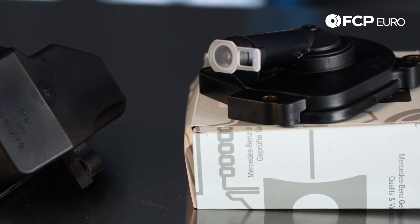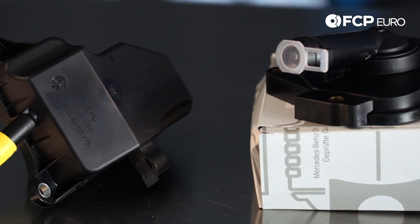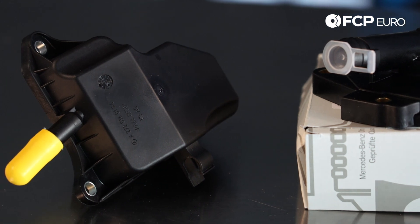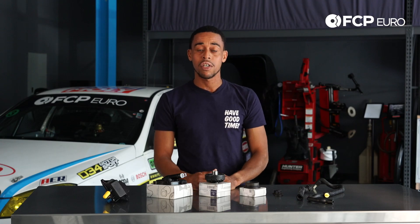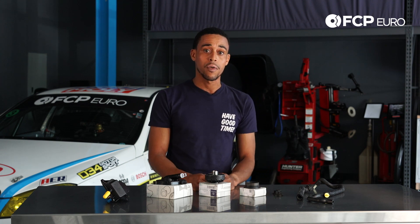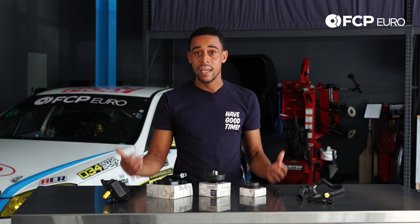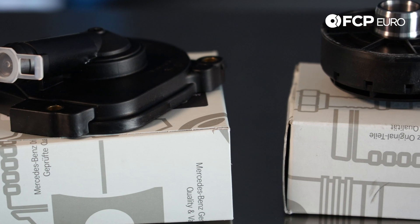After a good jaunt on a Sunday morning, you smell some oil burning — can't vent that excess crankcase pressure. It's probably your crankcase breather valve. It's not venting the pressure correctly. And unfortunately, as a result of that, you start burning oil. You burn oil through the caps on the back of the head. You burn oil through the cap for the oil separator.